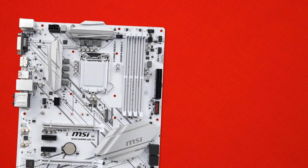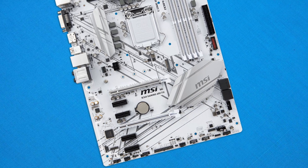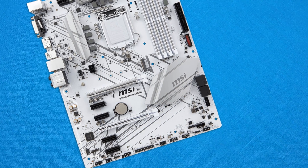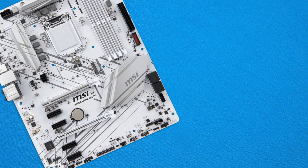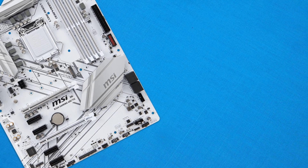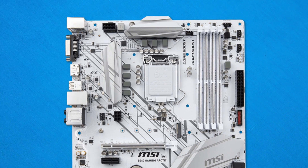On the downside, this board is actually still lacking in a couple of things. First off, there's nothing more than 16x or 1x PCIe slots, and whilst a lot of accessories these days are moving to 16x or 1x, it still would have been nice to see an 8x or some other option for variation. Also, whilst the SATA ports were nice to have five of, there is one facing upwards that I just don't like — all the ports on the right-hand side should be right-angle connectors. Thankfully most are right-angle, so you can just use those four and leave the weird upright-facing one, but honestly I was not a fan of that one random SATA port facing upwards.